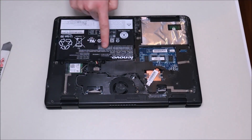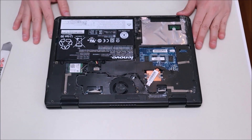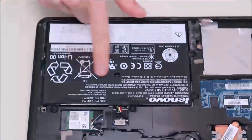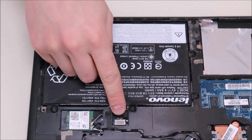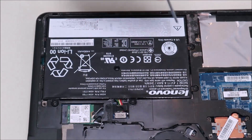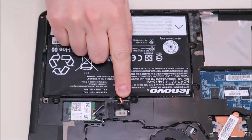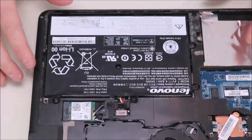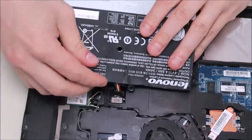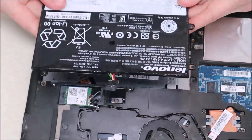So here now you have access to your battery and your wi-fi card. I'll zoom in so you can see the battery better. The battery is held in by two screws and then just a plug. To take your battery out, we're just going to remove these two screws. The battery plug is just a straight plug — it's just pushed straight in, there are no pins or clips or anything holding it. So lift the battery up a little bit, take it out, and then pull back on that plug and it should come right out.